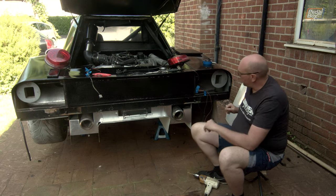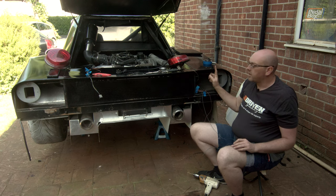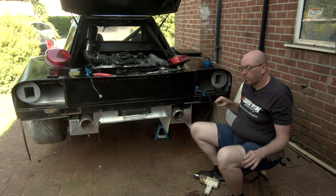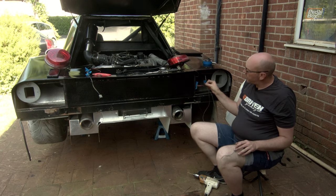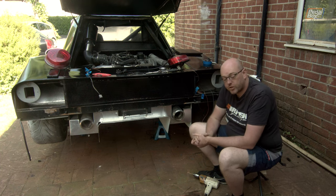We've had to unpick the reversing cable because on the TT the reverse light sits on the passenger side and the fog light sits on the driver's side. So we've unpicked this all the way back in the loom so it comes through over to here — we want one bundle of cables that drops down and plugs into everything we need in the centre. The fog one is already identified and ready to go, and we can use the common grounds on this side.